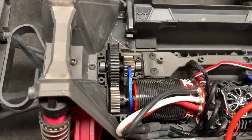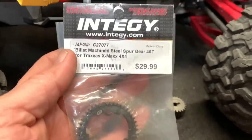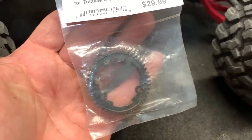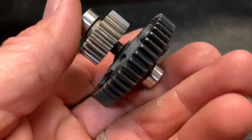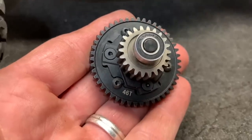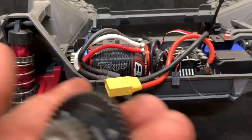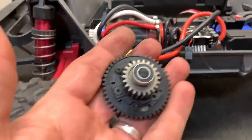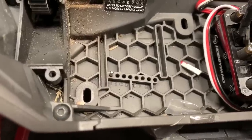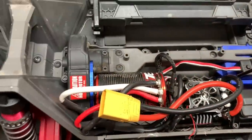It's time to change spur gears now. This is a spur gear I've had for quite a while, so we'll see how good an energy spur gear is. The 46 tooth is on — it went in really kind of snug, but that's kind of perfect. I know it's centered up and ready to go. Now it's time to get it in the truck and reset the pinion gear to get the mesh right. It's in the very first hole — there it is, ready to go again. Got that bolt in place.